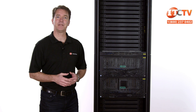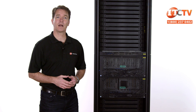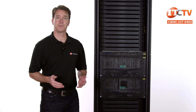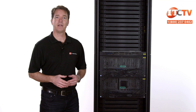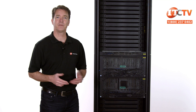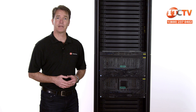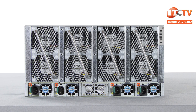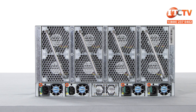The MC990X features HPE's Foundation software, which helps with fine-tuning the system and troubleshooting. It provides automatic boot-time optimization, reliability features, and technical support tools for high-performance computing. The tools maximize performance and availability of the MC990X servers. Many utilities run in the background automatically, but a few require configuration from the administrator. Foundation software tracks main memory health, monitors system performance, and enables CPU scaling to take advantage of Intel Turbo Boost technology. LEDs help administrators identify potential problems on power supplies and the motherboard, and just about everything has a redundant fail-safe to increase availability and reliability.